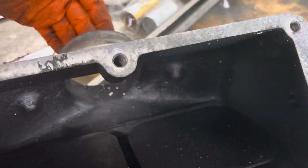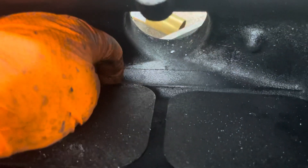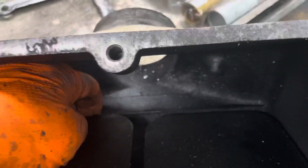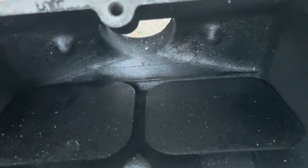You've got air coming in here from the turbo into this right here, from this side of the housing. You've got air going in, and guess where it's going? It's getting behind these flaps. What's happening is it's actually trying to bend this flap closed — the air is getting behind that flap and actually trying to bend or break that flap, pushing behind the flap rather than sliding right past it.